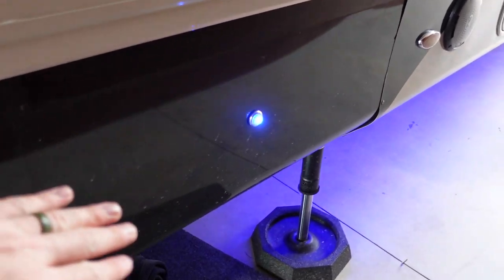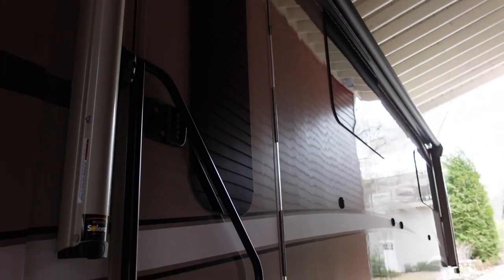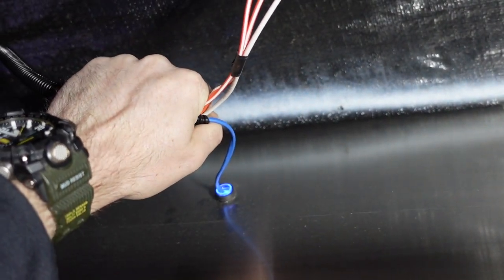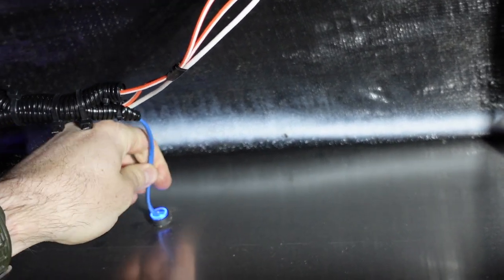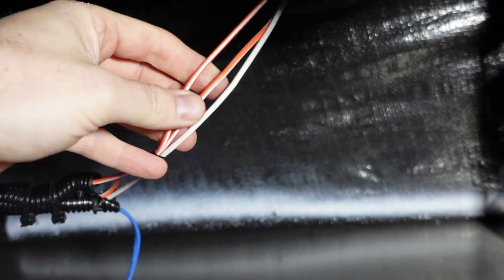The first thing I did was investigate the blue step light. From the factory, this blue step light is wired into awning number one — they're both on the same channel. If you hop under the coach, right under the entry door, you can see the backside of that blue LED step light. Here's the skirt board and the blue LED step light. From the factory, everything I'm holding in my fist is what I added with this mod. You've got the lead coming off the blue step light, and up here three wires total.